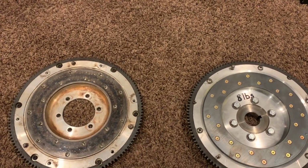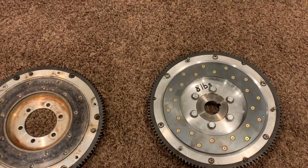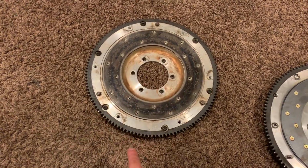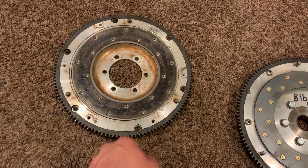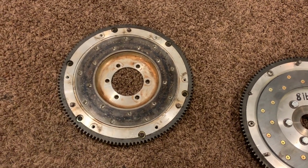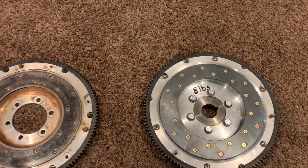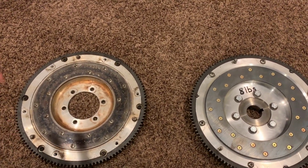But the difference between the flywheels themselves is the weight, without counterweight. This one's 8 pounds, which is why it's marked 8 pounds. And this one, without hardware in it, any of the nuts and bolts, is about 9.6 pounds. It's advertised as 10 pounds, so it probably is 10 pounds with all the hardware in it. So a little bit heavier, a little bit lighter. Make the choice. I'll put the links for both of them in the description below, but I thought I'd let you guys know.